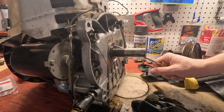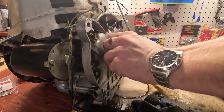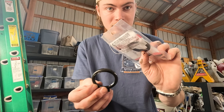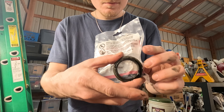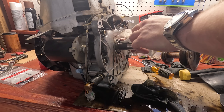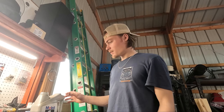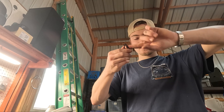I'm back in North Carolina. I got a new seal for the mower — let's see if it works. So I was looking into how to replace this seal, and there's an easy way and a hard way. The hard way involves taking the entire engine apart, because you have to get the whole crankshaft out to replace that seal, which is really the right way to do it. The easy way is to just gouge that old seal out from the outside and tap in a new one. So I'm going to try the easy way first and see what happens.